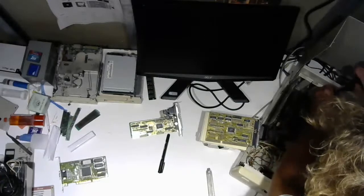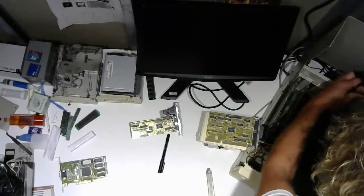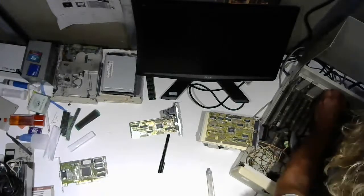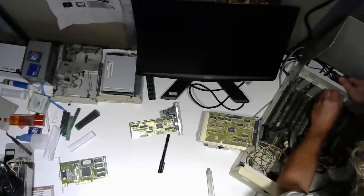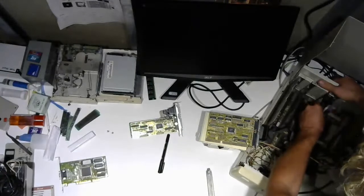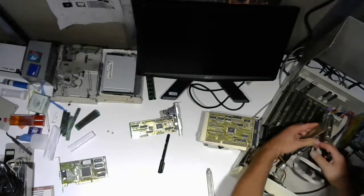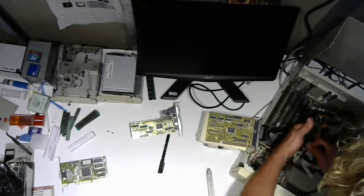So far, 3 out of the 5 floppy drives worked without any intervention. Well, yes. One had the heads cleaned, which needs to just be put back together, and the other one needs the eject button put back in. So I'm satisfied there. The memory seems to be holding up, so that's also good. Weird things are happening when you boot into Windows, got some weird artifacting.